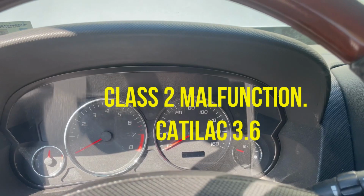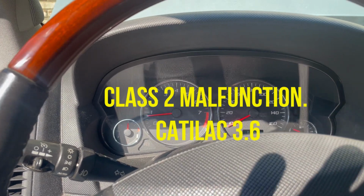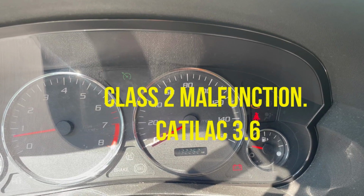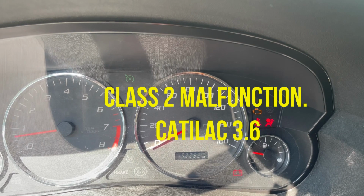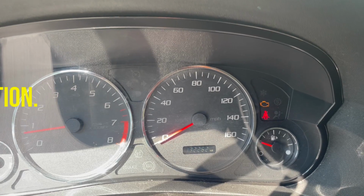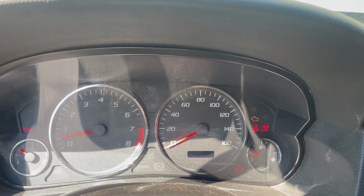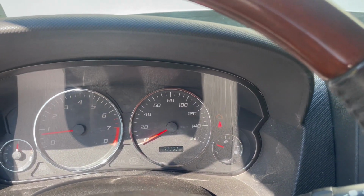Check engine light still on, starts up. So we're gonna do it several times probably. As long as that check engine light is on, the vehicle will start. Just like that. So that's where we're at, guys. When the check engine light's not on, when you turn the key to the on position, the vehicle won't start and you won't be able to pull out the key. Those are the symptoms.